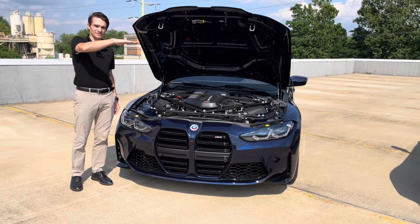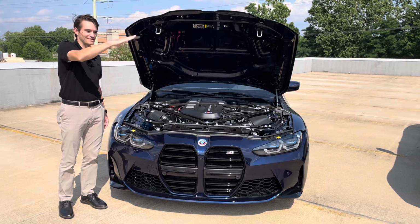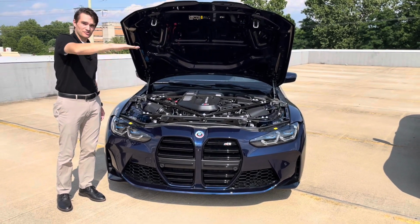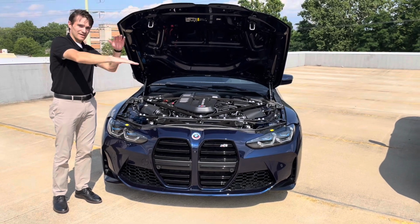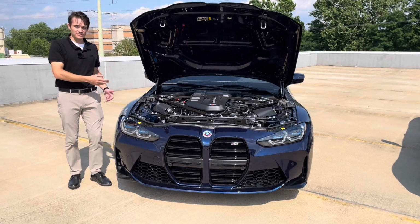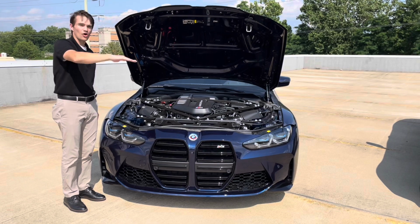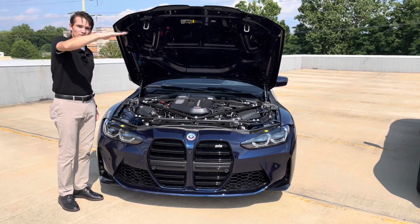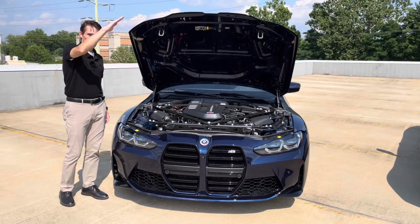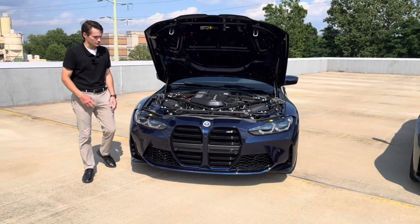if you watch my hand and pretend that it's a piston, right now I am an oversquare engine. I'm moving really fast, but I'm not moving a lot. Now I'm an undersquare engine. I'm moving a lot, big range of motion, but I'm not moving very fast. In an undersquare engine, if this was an engine, I'm generating more force when I move more in a larger range of motion. Going like this, I move really fast, I make a lot of horsepower, but I don't generate a lot of force. Generating more force like this is where you get the torque, the increased torque in the undersquare designs as opposed to the oversquare design.